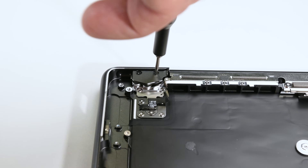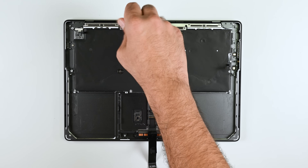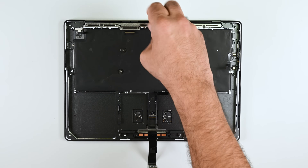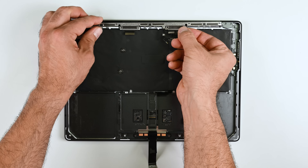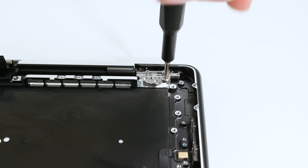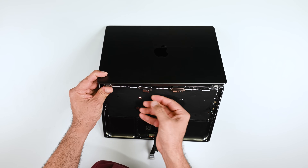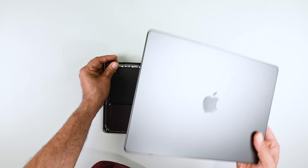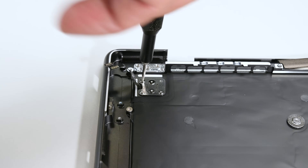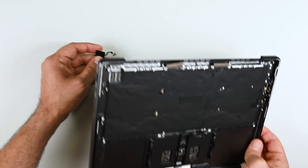Next, I'll remove the screen, starting with the screws securing the hinge brackets, which are both stuck behind the antenna bracket — so that component also needs to come out. The antenna bracket removal is a tedious affair, especially with the multiple tiny P2 screws involved. With the hinge brackets out, I have access to the hinge screws, which release the screen. No battery replacement is complete without removing the single most delicate and expensive component on a device, second only to the logic board — but it's not a terribly complicated process. With the screen away, I can now access the Touch ID sensor, held in by a few screws and sliding out from underneath the case.